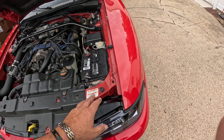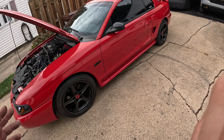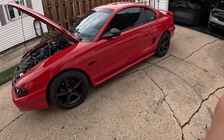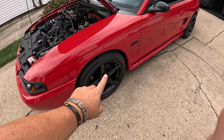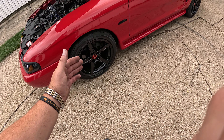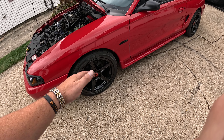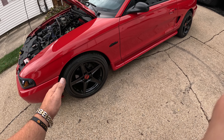I'm just doing a little check — check your brakes, obviously, and check your tires. Another thing you want to check is your tread wear pattern on your tires. Maybe your camber is off and you're wearing the tire unevenly, which means you'll go through tires a lot faster.